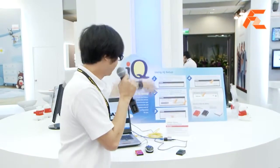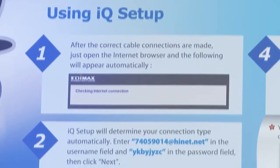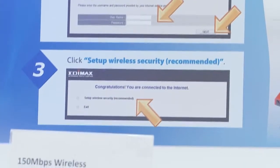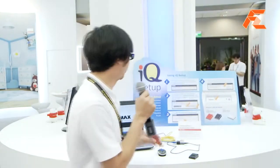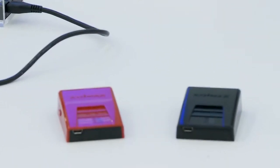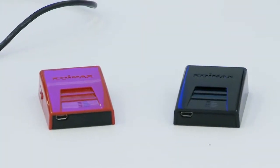As you can see here, after you have made all the appropriate connections — routing to your modem and to your laptop computer — the next thing you have to do is just click open your internet browser. The usual scenario is users have to key in an IP address like 192.168.2.1 to access the user interface, and then you have to determine if your connection type is PPPoE, dynamic IP, or static IP.